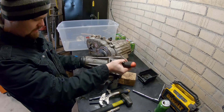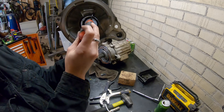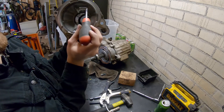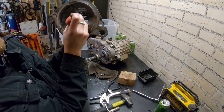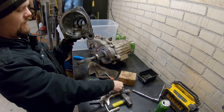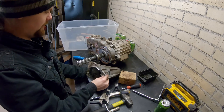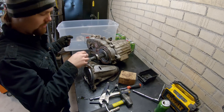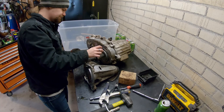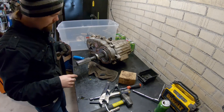I don't have circlip pliers, so this is what I made work. See this giant clip here? I didn't have circlip pliers to come in the top and open it, so I had to make do with some screwdrivers and pliers, and it worked okay — but definitely get some circlip pliers, some snap ring pliers. I'll be getting some before I finish this. The closest thing I had were these, which are meant for holes. That clip holds it onto the bearing, and a good pair of circlip pliers would have made that much easier.